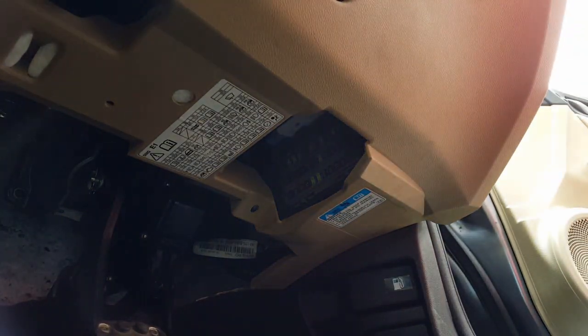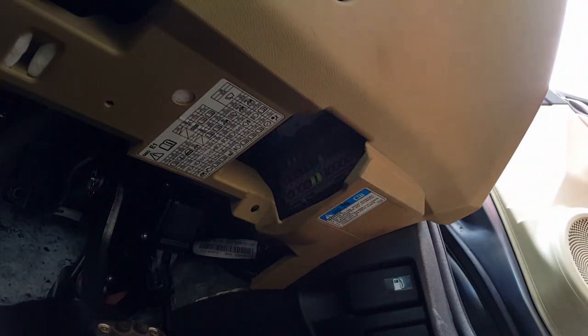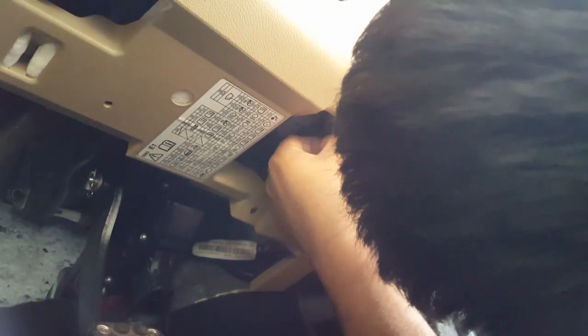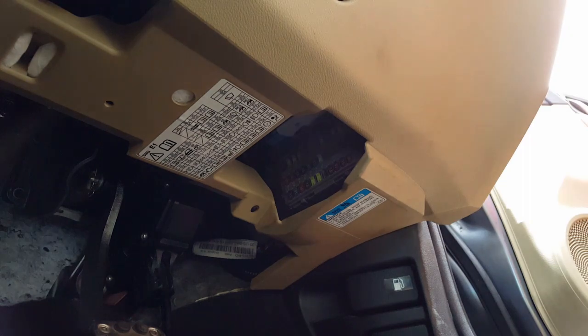Immobilizer. Where's the immobilizer? Hang on, let me look at the Autodata. Okay, that was empty. Engine control module, sunroof. F21, second row. Okay, there's one here. Still reading 0.3. Come on, go back in there. And the next one as well. Still reading 0.3.